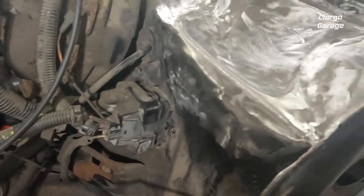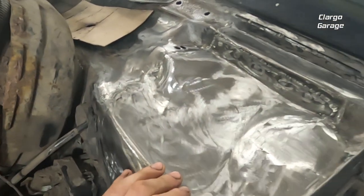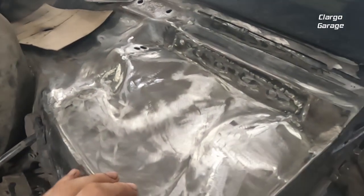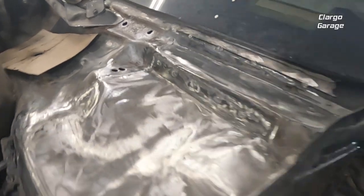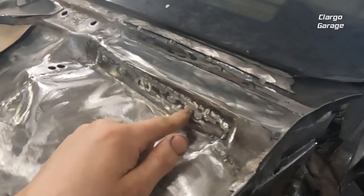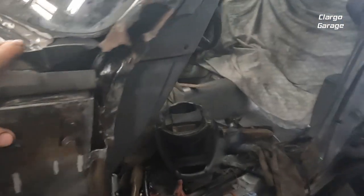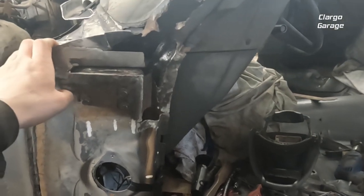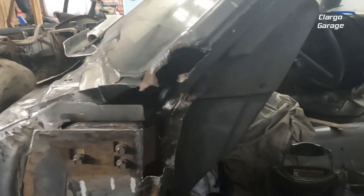All in all it turned out pretty good — 100 times better than that big gaping hole that was here. I'm going to put a good primer on here and some paint, and do that before I put the top piece on, then just clean the paint off the spots where I need to weld. You can see my weld line there — I did some rosette welds on it as well to try to get a little extra strength. There's a lot of strength up in this area of a vehicle, and same with along here too, which is currently missing but we're going to get it all back. This is all heavier metal — I'm going to use 18-gauge metal for here, and then the top part feels like 20 gauge.